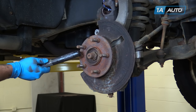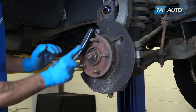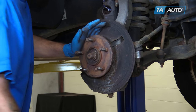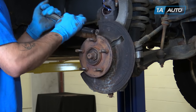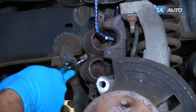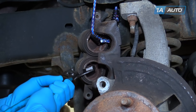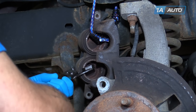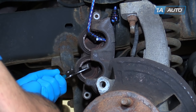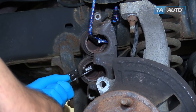Using a heavy wire brush, remove as much of the rust scaling from the hub and the studs as you can. Using a large pair of water pump style pliers, compress the calipers one piston at a time. Be sure to go slow so you don't damage any seals or force any excess brake fluid out of the master cylinder. Also, going too fast can cause the other piston to come out.